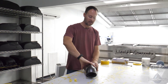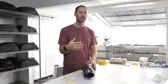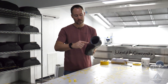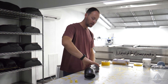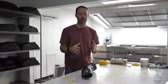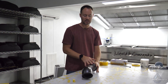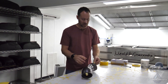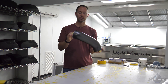Nobody's looking underneath the car, so they're not really going to see the bottom part. But if you want the best possible look, rolling is going to be the best way. However, whenever you start adding in curves and elbows like that into the part, that's what makes it really tricky because the roll doesn't quite work out. As you're going down into it, there's not a defined line, and the line can be moved and stretched. So even with a slight curve right in here and a slight curve downward, we're going to dip this almost straight down into the water. A thing I like to do is take a piece of tape on the inside of the tube and put a little piece right there, as well as put a little piece right here.